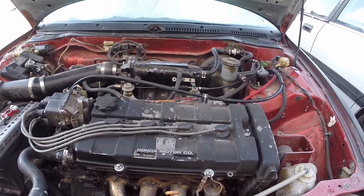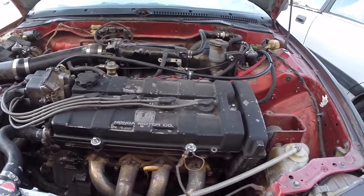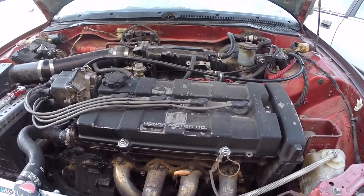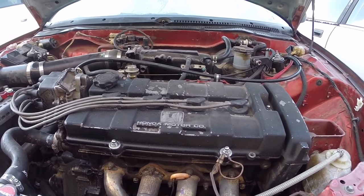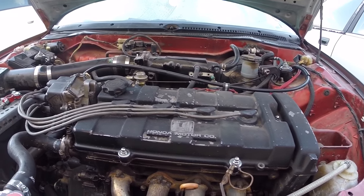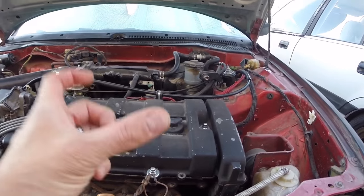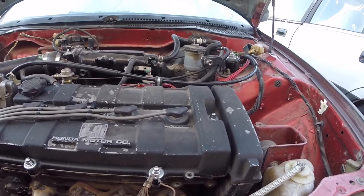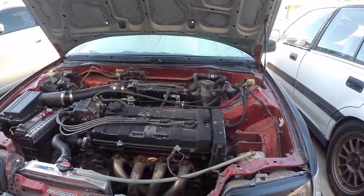The compression test gives you an idea of which cylinders are healthier than the others. My problem is in cylinder number one - this car smokes a lot, so more than likely the rings are bad. You can also do a wet compression test, which involves adding a little bit of oil to each cylinder as you do it - that'll raise the compression slightly and give you an idea if it's sealing with the oil. Thanks for watching guys, hope it helped out, if you need any help let me know.